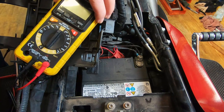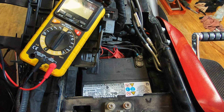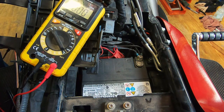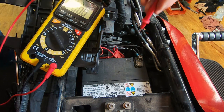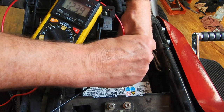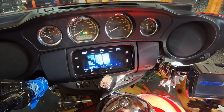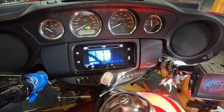After charging the battery Thursday all day, I came out on Friday and was able to start it up. I've left it sitting since last Friday and this is Monday afternoon. Let's see what our battery voltage is at. We're at 12.4 volts. So we're going to go ahead and start this after it's been sitting for a few days with the normal parasitic drain from the alarm and see how it does.